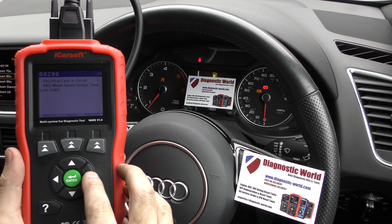Let's click on clear fault memory for that and see if we can get rid of them. So erasing fault codes — erase operation done. You'll notice the lights are still on though. What we need to do is back out of the ABS module system on this kit, and then we'll see the lights turn off. It's generally how these VAG cars work. And there we go — all the lights have gone off now. Obviously the parking brake light is because we've got the parking brake on.